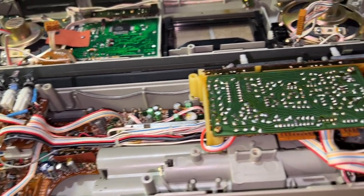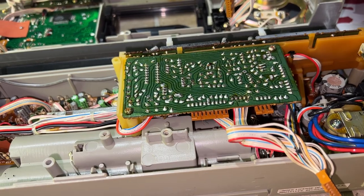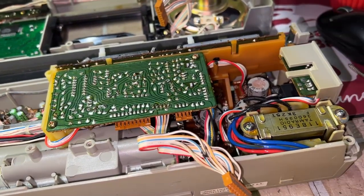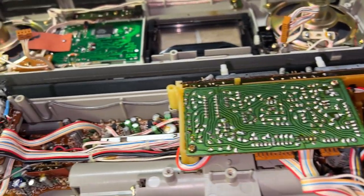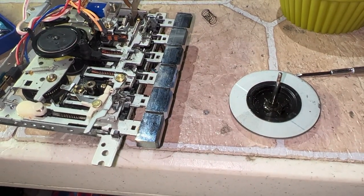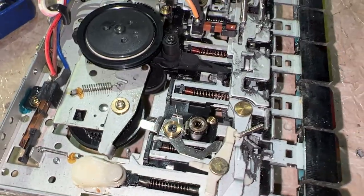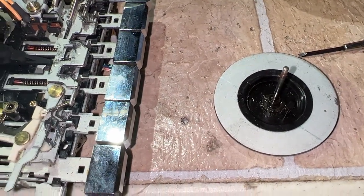And there it is with the tape transport removed. Just looking around inside there. Yeah, everything's socketed. You could easily unplug it. It was meant to be serviced. It's not disposable. These were good things. They paid for it. You got what you paid for. I mean, it's 40 years later, and all I did was change the belt and lubricate the tape transport. There it is. Got it taken apart. Metal flywheel. Yes, it is 1984. They started using plastic inserts on the flywheels, but it's still much different than anything after that, the Tanashins, blah, blah, blah.